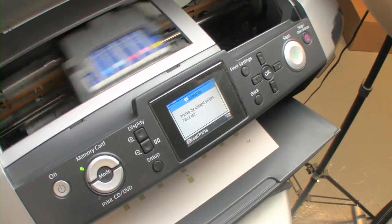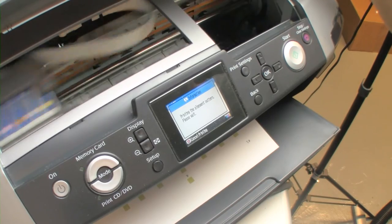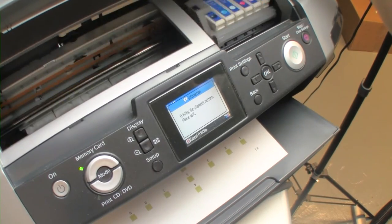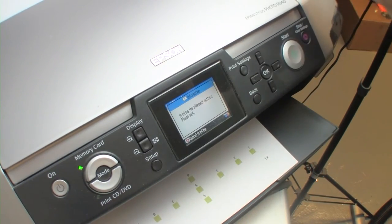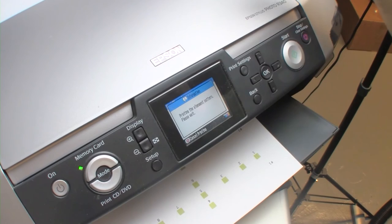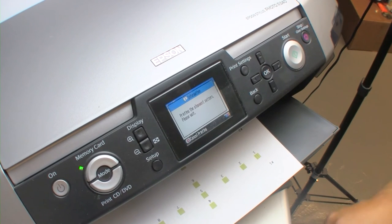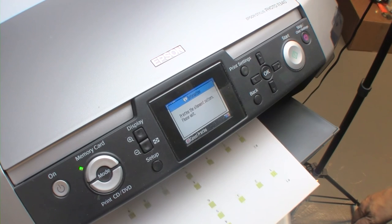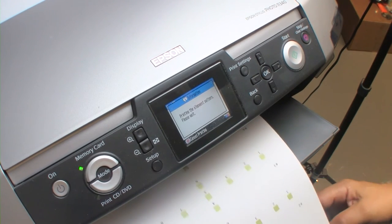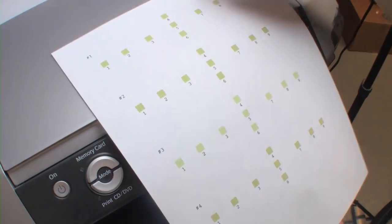That's not something rare — remember, printing borderless sends a lot of overspray. These printers do not have an aspirating system, so the overspray is like a little cloud inside the printer and it will deposit itself on anything it can conveniently land on. If it lands on that encoding strip, you're in trouble. It just requires a wipe with a Q-tip or one of those special applicators — use something that won't leave a residue, like alcohol or even distilled water.